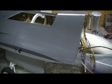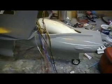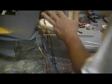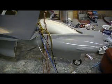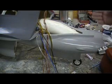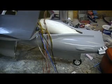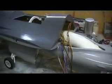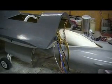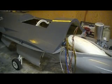But I'd do this on a new plane too. That's better than putting it all together, especially like this jet. To make everything real neat looking, you have to layer it. And I always start with my airlines first. But the bad thing is that they're buried, and if you do run into this situation, you've got to strip it. But this airplane only took me about 30 minutes to strip. And see, that's another thing when you're setting these things up, I try and set them up to where I can take them apart and work on them.